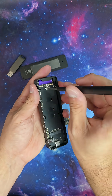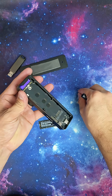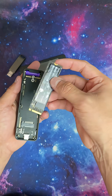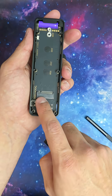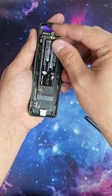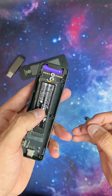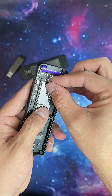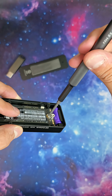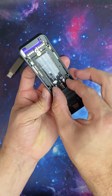To put the M.2 in, we're going to unscrew this back portion right here and get that screw completely out. The hardest part of this entire process is actually getting that screw back in because it's so small. Now we're going to take our M.2 and line it up with these two little inlets right there. When you have it in right, it will be like that — you do want it at that canting angle. Then press it down, take your screw, line that up in that insert hole, and screw it down. You don't need to screw it tight at all — just finger tight. There should be no wiggle, no wobble, nothing.